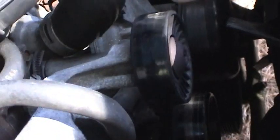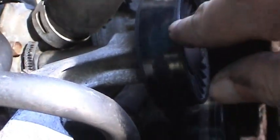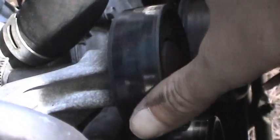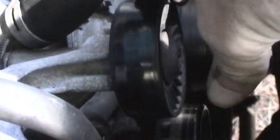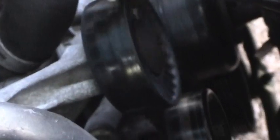Moving on to the idler pulley — that's got some significant wear on there. This is just plastic. Those bearings in there sound extremely dry, although there's not really a whole lot of play in here, so from that perspective they're in good shape. But that's probably what's making my chirping sound in the morning when I start it up cold. I can actually feel the individual ball bearings rolling around in here. So I might go ahead and replace this bearing when I do the cooling system.